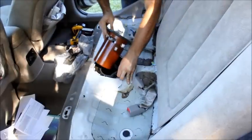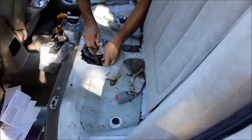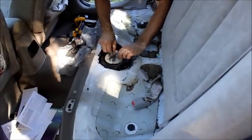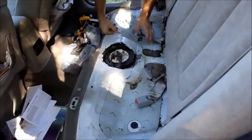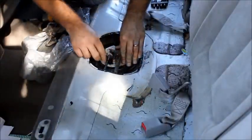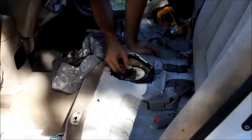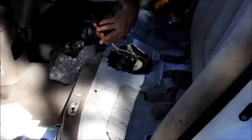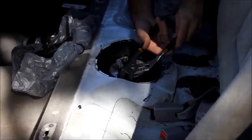We're going to be reinstalling - hopefully. Reinsert the pump assembly, finagle it around a little bit. Take these fuel lines around it. This will need to be at about that angle. Now these things are spring loaded, so it's not going to actually meet up flush. You have to push it down and screw it in at the same time. Push it down, line up your holes, and get a couple screws in there to hold it in place. Hook our fuel lines back in - this one just snaps in place. Hook our clips back on.